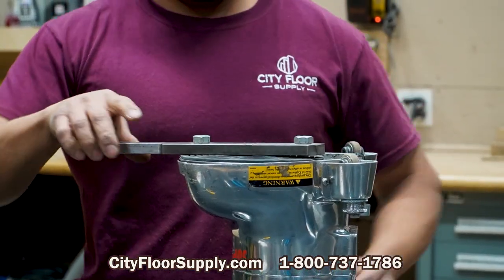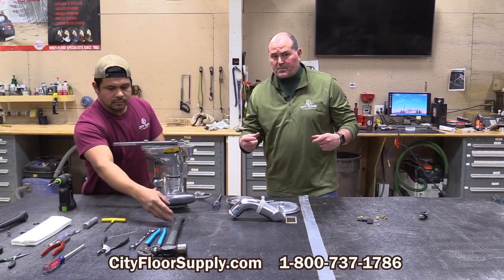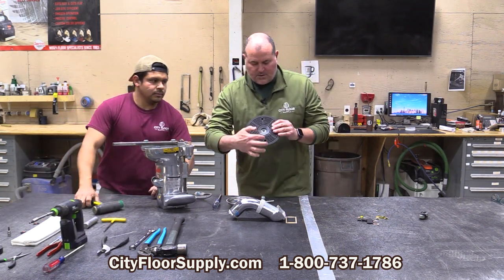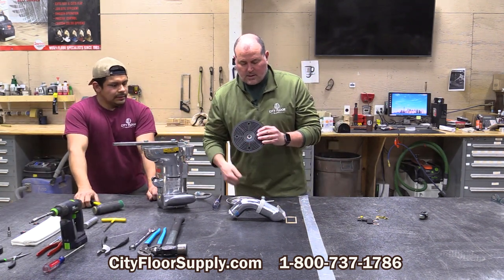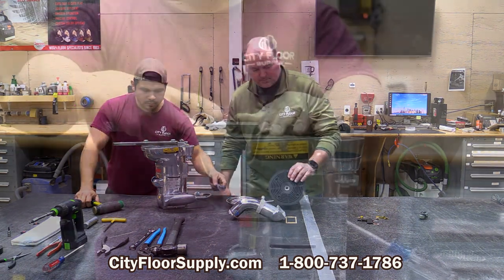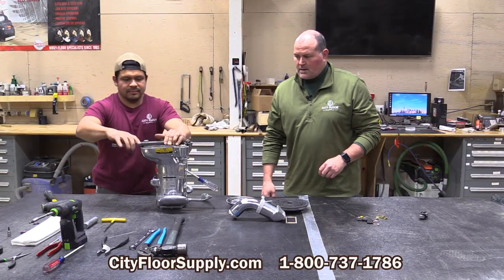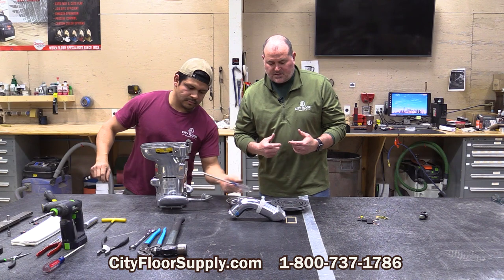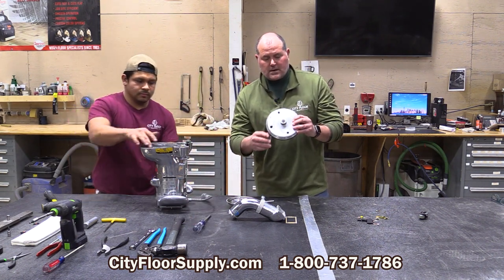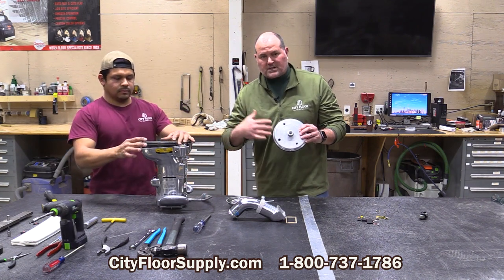This tool here is our spanner wrench — we make them here in the shop. You can make something similar with a piece of steel and some bolts that are this distance apart and it'll work just fine. You should use the same techniques that we're doing here. That quick hit is to break that threading free so that we don't disturb the pinion gear, which is threaded onto the armature as I was talking about earlier.